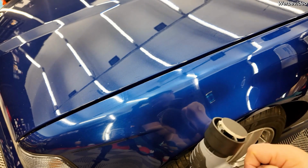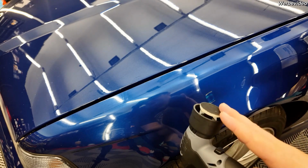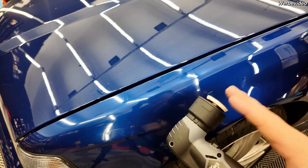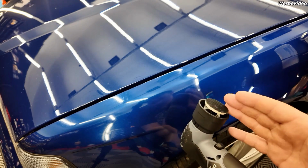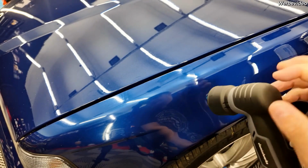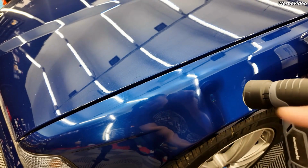That's why today's video is just a little introduction to the topic of rotation. There will be much more on this in the coming weeks and months. And I don't demonize rotation, but I just don't recommend it to any beginner who has never polished before to start sanding a nice fender with rotation. You can certainly do it, but you didn't get that tip from me.